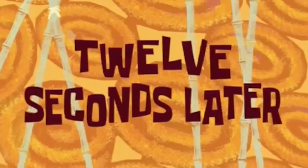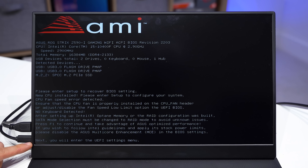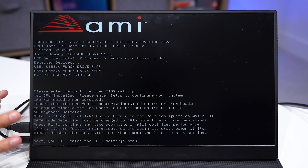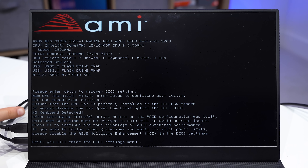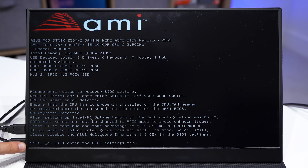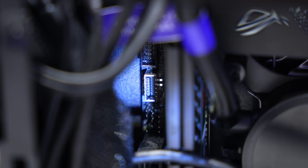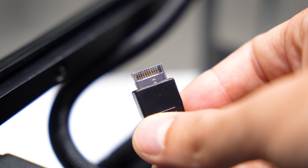12 seconds later — whoa, whoa, whoa. Hold on. In hindsight, I'm really glad I tried this. That is shocking. This is like a totally different set of warnings here. This is totally normal — like, no keyboard detected. It thinks we swapped CPUs and that we don't have a CPU fan connected, which is true, but we're not getting the overcurrent warning at all. In fact, it looks like it's going to try to boot us into the BIOS for the first time since this rig was assembled. At first glance, everything looks okay here too. It looks like just disconnecting the front Type-C connector has fixed our overcurrent issue. What a shocking twist.